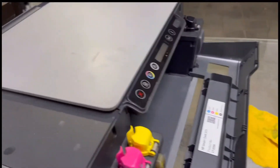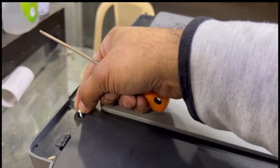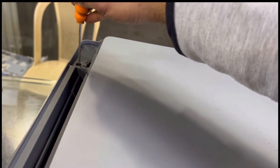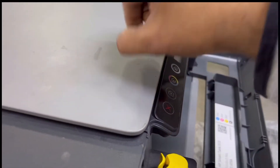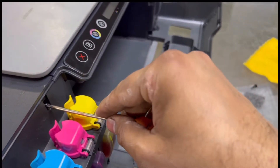The top cover is returned. We will place our screws back and check whether the carriage is still moving abnormally or is it fine now. The problem was the encoder strip being out of the sensor — that's why the ink carriage was not reading correctly. You need a five-star screwdriver to remove these screws. If you don't have one at home, you can get it from the market.